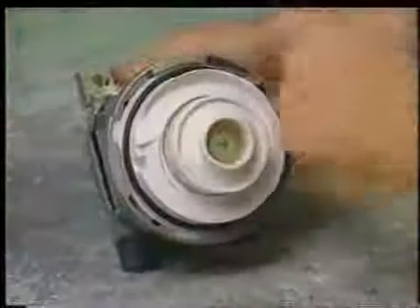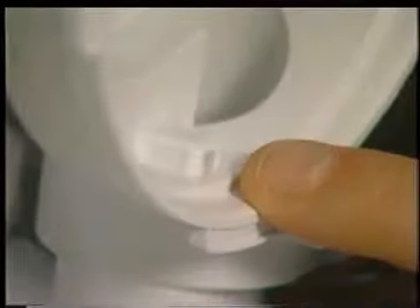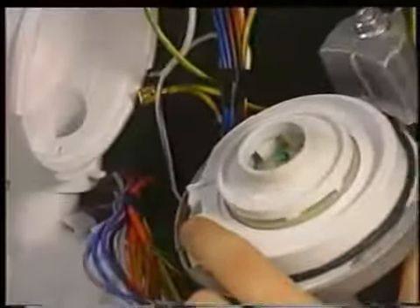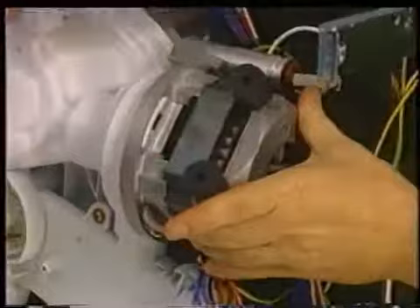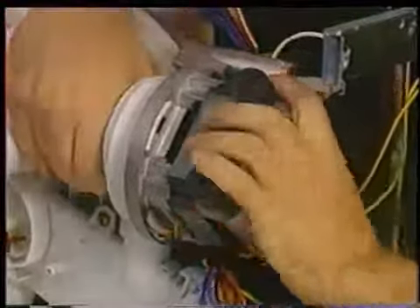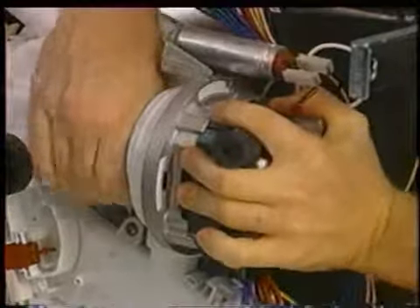With the motor and rear pump housing reassembled, you can replace the motor. First locate the key square on the front pump housing — this key square will insert into a notch on the rear pump housing. Line up the key square with the notch and then mate the two halves of the pump housings, pressing firmly to compress the seal. Make sure you support the sump as you apply pressure. Then turn the motor counterclockwise until secure. Now reattach the wiring leads.